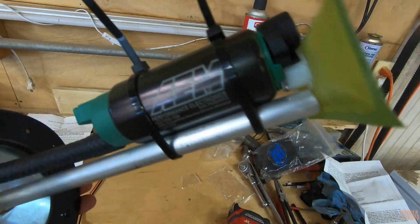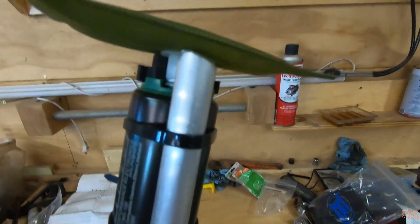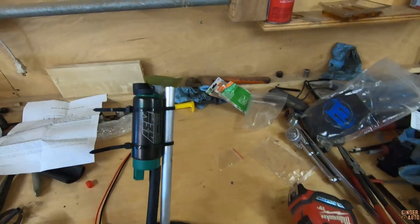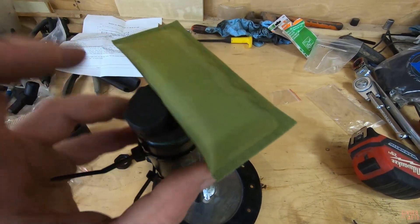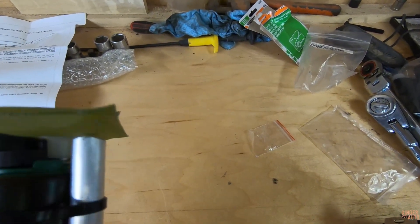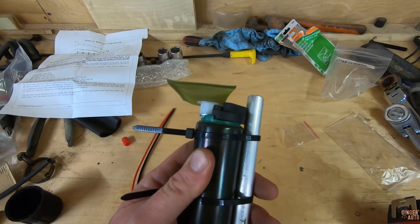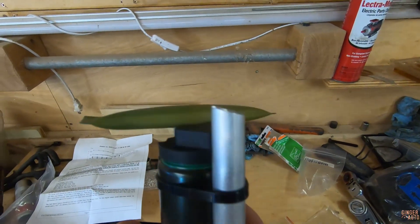I kind of realized this tube is going to go to the bottom of the tank because the mechanical pump is sucking fuel — you want it at the bottom. I just need to make the hanger so the bottom of the pump is even with the bottom of the tank. But you don't want to make it too long — you don't want it sitting completely on the bottom, just barely not touching. So I'll adjust it so the filter is just barely shorter than the tank depth. That should be the right length.